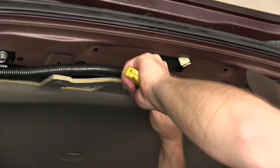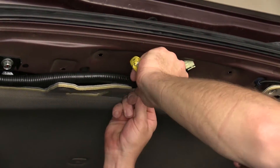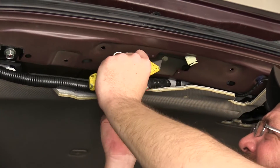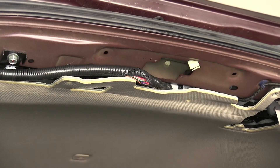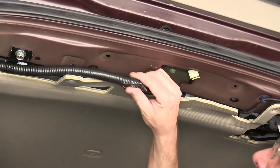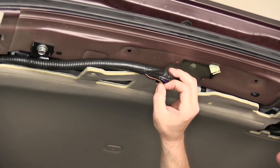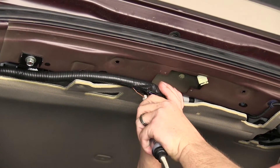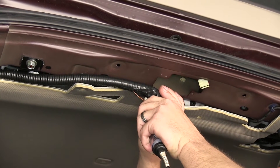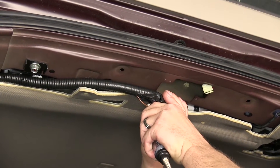We'll use our utility knife to cut the electrical tape and open up the wiring loom. For this application, we're looking for a brown wire with gray stripes — this will be for the reverse light circuit. Note: in order to test your reverse light circuit, the rear hatch door must be closed to activate the circuit. Then you can use your test light, putting the vehicle into the on or auxiliary mode and putting it in reverse while firmly keeping your foot on the brake pedal.